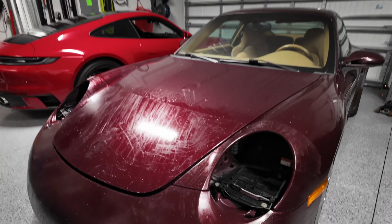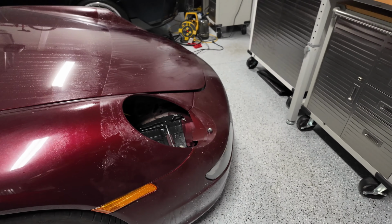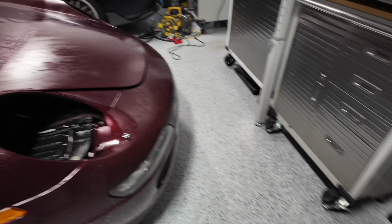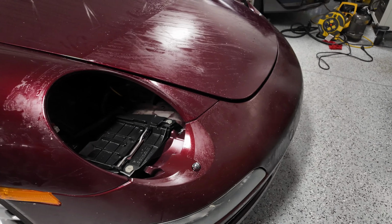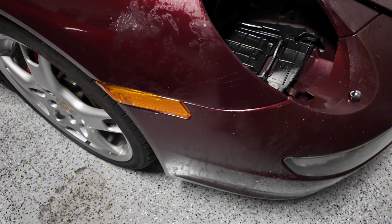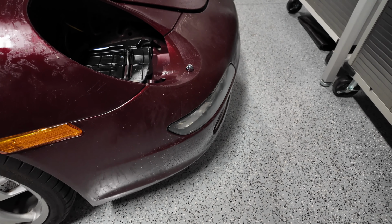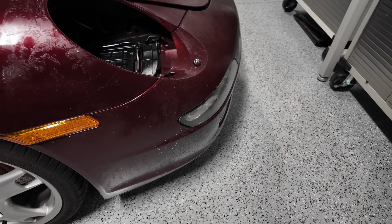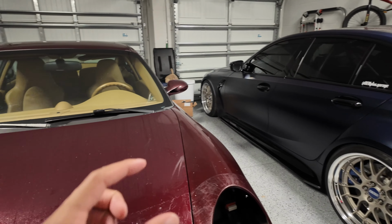All right, guys. Day one of the PPF removal. 20-year-old PPF removal complete. What can I say? I took the headlights out so I can polish them, try to get them a little bit cleaner, and they came out decent for now. But yeah, this sucks. This adhesive is insane, so I have to go MacGyver and figure out how to get some of that off, essentially. Got some different adhesive remover coming in that I'm gonna try on that. The key with this whole process is steamer, plastic razor, and just taking your time. And yeah, it was coming off in little sections like this big.